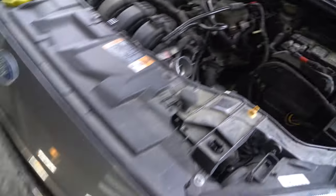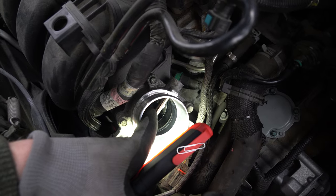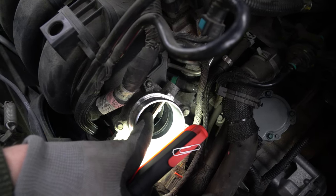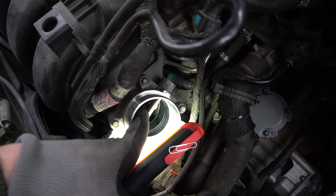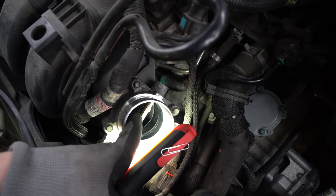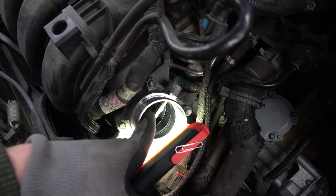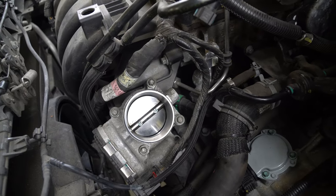It is going to rough idle when we restart, but we'll go into that more later. Just attention and care — spray, don't have to go overboard, and just keep wiping away. Make sure you do not rip your cloth, and if you do, get all pieces out of there. If you can't reach it, use a vacuum cleaner — it'll suck it out. For the deeper cleaning, use the toothbrush so there's less chance of it getting caught in there, because the last thing you want is to start this thing with any piece of paper towel in there — it'll get sucked into the motor and cause you a whole lot of heartache.